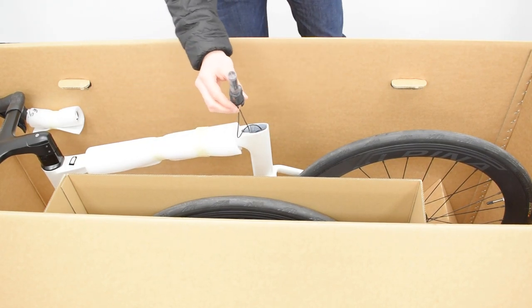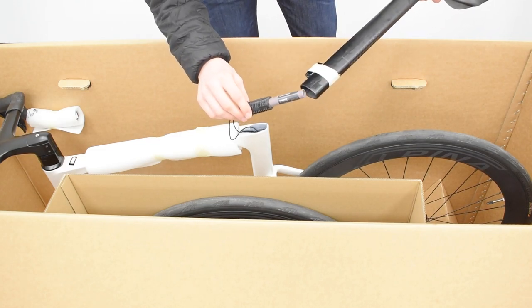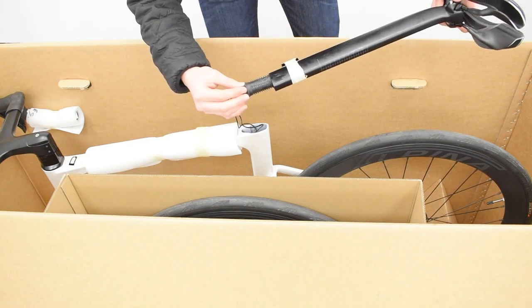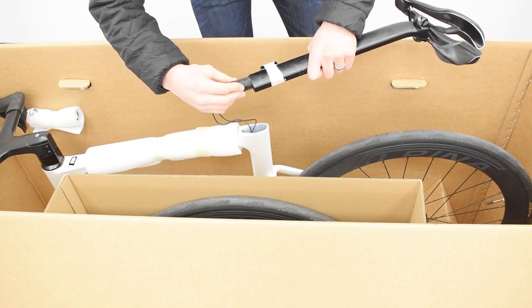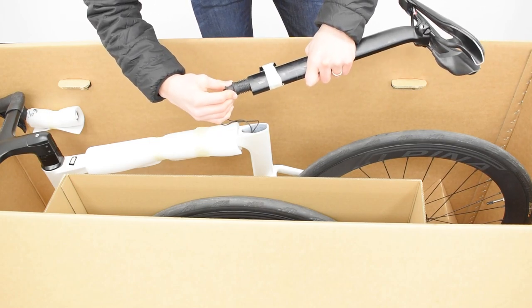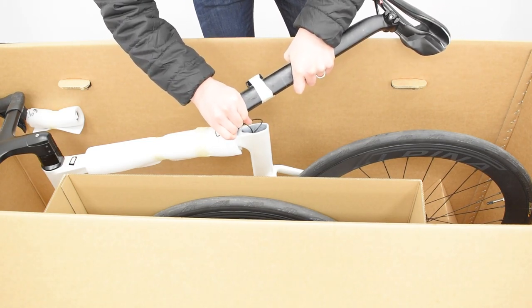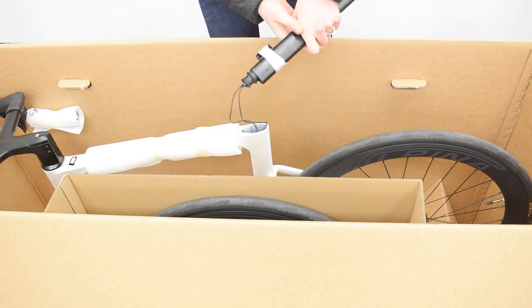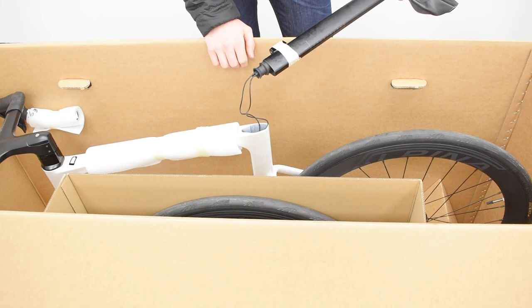What we're going to do now is take the battery and insert it into your seat post, making sure you insert it into the wider end of the seat post and put it in nice and firmly. It can be quite a tough job but once it's in there it should be very secure. There's your Di2 battery inserted into your seat post.